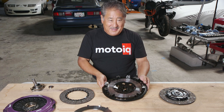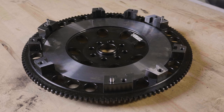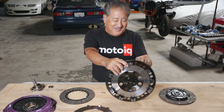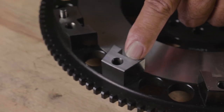The next part of the X-Clutch system is the flywheel. It's made out of forged chromoly billet, so it's really strong, has good grain flow, a lot of burst strength, and it's lightweight — it weighs about 11 pounds, while the stock Subaru flywheel is about 19. You don't want to go super light on a Subaru if you're keeping the stock engine management, because super-light flywheels tend to trigger multi-cylinder misfire codes. Through trial and error, Subaru tuners have found that about 11 pounds gives you better response without triggering the check engine light. The flywheel also has holes around the periphery and center for additional lightness, and machined-in guides for the rest of the clutch system.